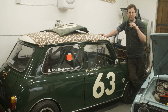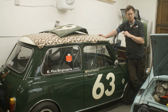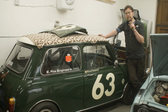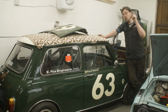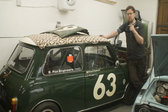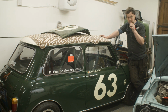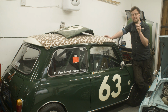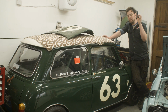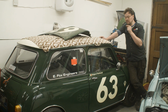You might wonder, why would I get a needle leaner? You might say, the needles that are in it are already too lean. Why would you get a needle leaner? Well, the reason is I got a needle that was leaner across the whole profile. What that is useful for is when the rolling road operator needs to produce a very specific profile. If he has a needle that's leaner across the whole profile, he can then modify that needle in any place he wants to make it richer and make it exactly what he wants. So that was the theory behind that.